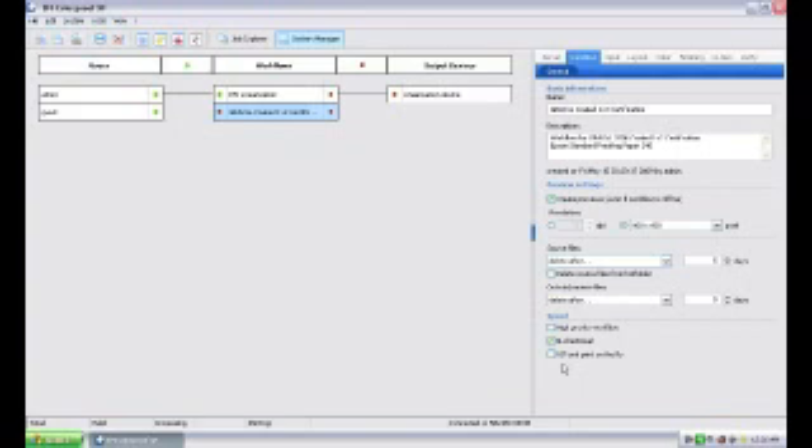We also have a high-resolution 1440×1440 RIP mode. To process complex files — say four color plus spot colors at a large page size at that resolution — if you wanted to run RIP and print on the fly, you'd need a super beefy computer with the latest processors, memory, and fast drives. So leaving that unchecked is probably best. We don't want the printer pausing; if RIP and print on the fly can't keep up with the printer, you'll see a pause in the print. The 900-class printers — whether 7900 or 9900 — with that new thin-film piezo print head are so fast that even in 1440×1440 output mode, unless you've got a really high-end computer, it's hard to keep that machine at full speed.